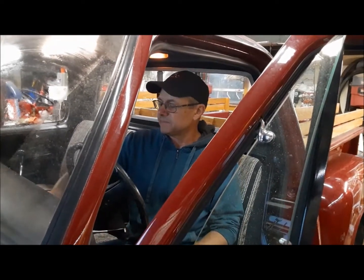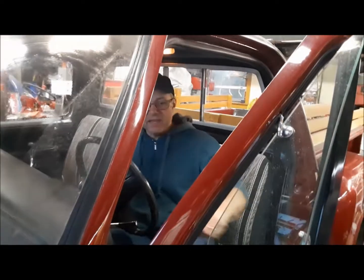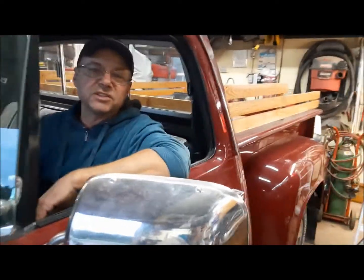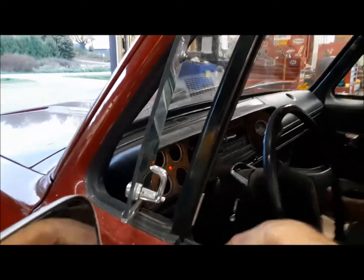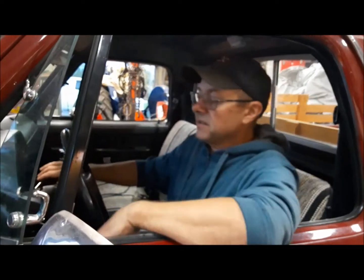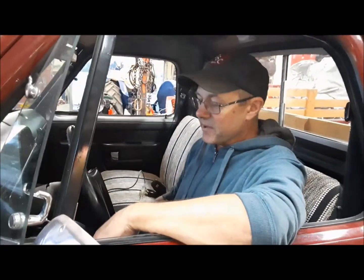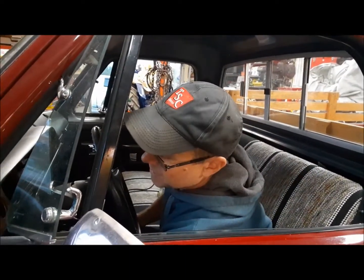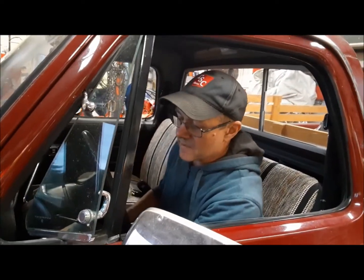So we've got a couple of lights to fix, figure out why the hazard lights don't work, and we'll be good to go. Last thing while I'm in here — emergency brake. We'll set it. The light comes on in the dash. Put it in drive — truck doesn't move. Release it — the light doesn't go off, but the truck moves. So that's another thing to fix. Probably got to adjust the cable underneath so when it releases, it pulls the switch back up.